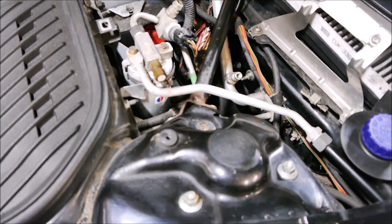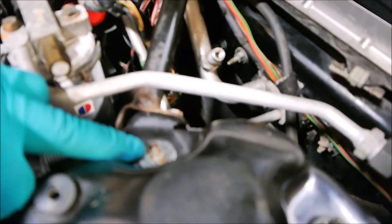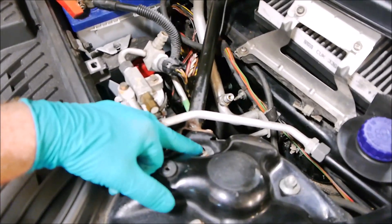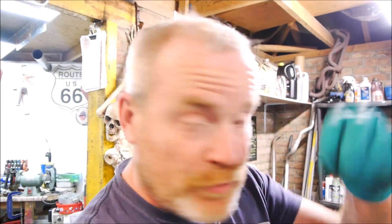What do you spot there that's wrong? Yeah - look at that. Snapped stud. So someone's gone to adjust the suspension and snapped it. I've now got to take that out. I'm going to try and drill it out first, then try and press it out, because it's more like a wheel stud - it's got splines in the cup - so I should be able to push it out. I may have to remove the strut but I hope not.